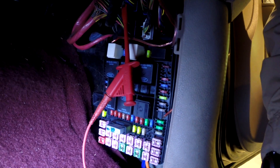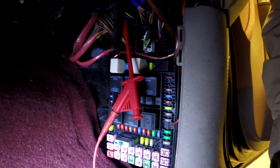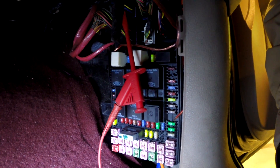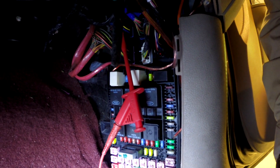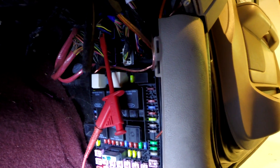We're going to replace this box. As it turns out, this isn't the only Ford Expedition with this particular issue — this has proven to be a common problem. But like I said, fuel pumps can also be a fairly common failure. So the thing to do is this test: hook up the fuel pressure gauge, hook up your voltmeter, watch the voltage and watch the fuel pressure. If it happens the way we just saw it occur, then it's the junction box and not the fuel pump.